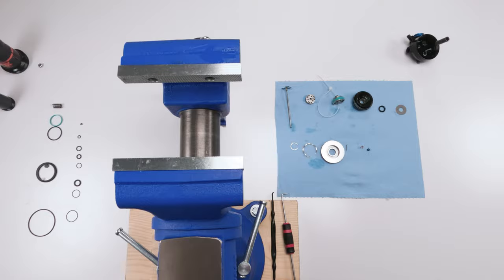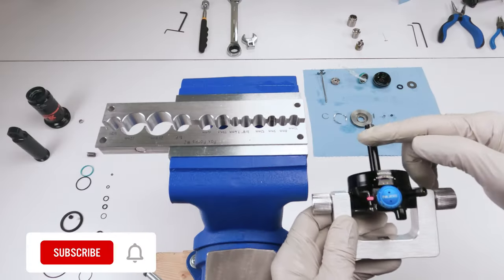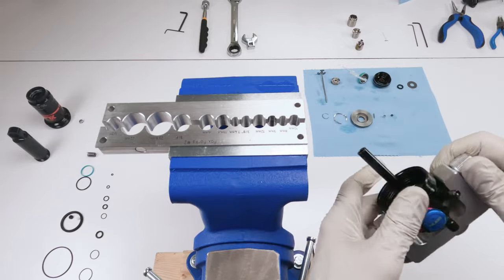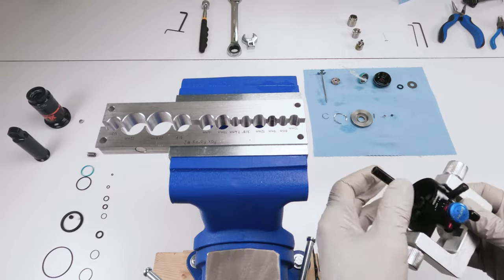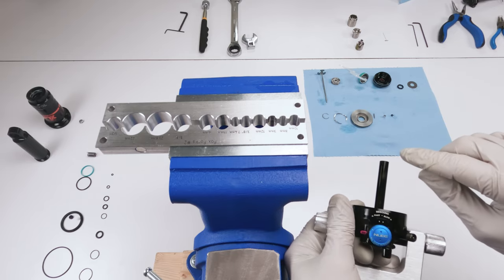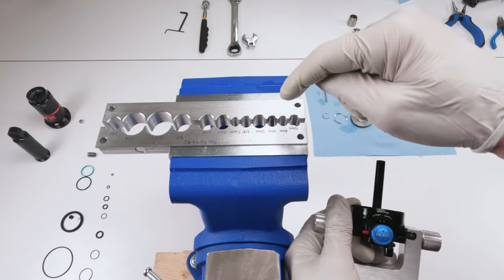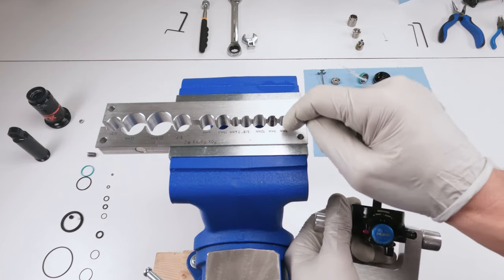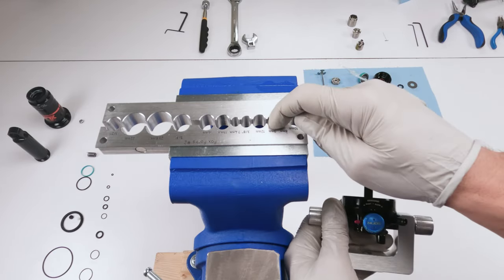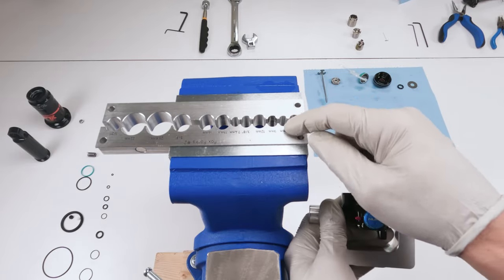All right. Next up, we take apart the head. So next up, we separate the shaft from the head, right? In order to do that, we have to install our trunnion mount adapter so we can unscrew the head from the shaft, right? Now, make sure that you clean this shaft of all grease. Even inside metal soft jaws, and printed soft jaws or poly soft jaws will not work for this. I'm telling you, you're gonna have to really clamp them down and they'll slide. So 9mm, if you have aluminum soft jaws, even better. So you could try it with polys. I've tried it and it slips.